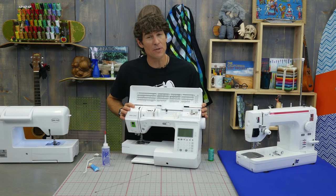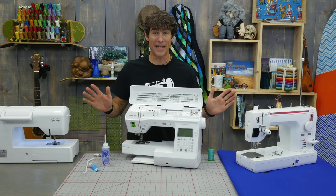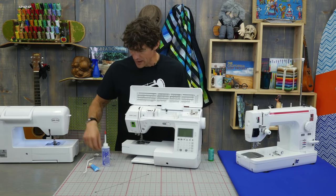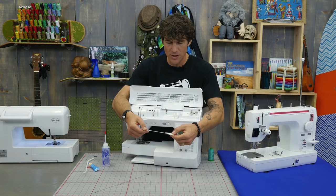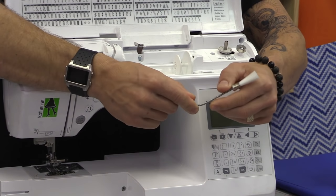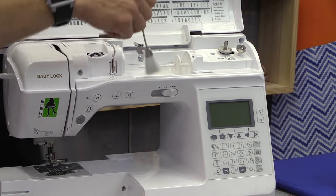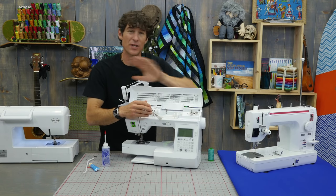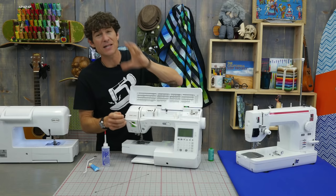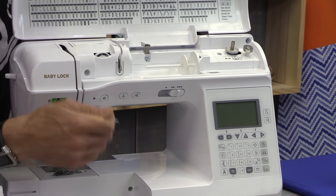Whenever I'm working on a sewing machine, the first thing is the power is off. We'll be taking the needle out, but the power is off so I don't get wounded with the needle. We're mostly dusting first — we do all of our cleaning before we do our oiling. I like these fantastic little lint brushes here. They can be bent if necessary to get into different angles, with nice nylon bristles. I never use cans of spray air — they build up CO2 and blast moisture and mud into your machine. So I'm just getting all the surface lint off as I work my way through.